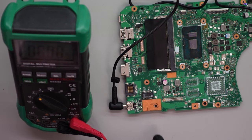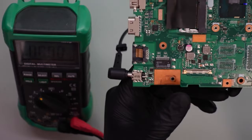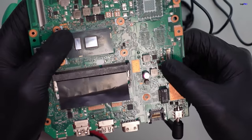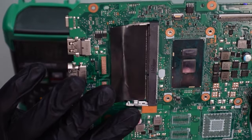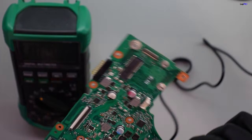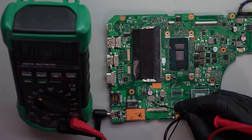When we flip this over, we see something interesting that's typical for most boards. Where we have a power input, there are usually like two MOSFETs and a current resistor. We just want to follow the path of electricity — that's kind of the whole point. If there's a problem here, there's not going to be electricity to the rest of the board. If I measure across these two MOSFETs, I should be getting 19 as well — and we do get our 19 there. You're going to have these throughout the whole board: coils, two MOSFETs, coils, two MOSFETs — delivering power to RAM, CPU, GPU, and other areas.